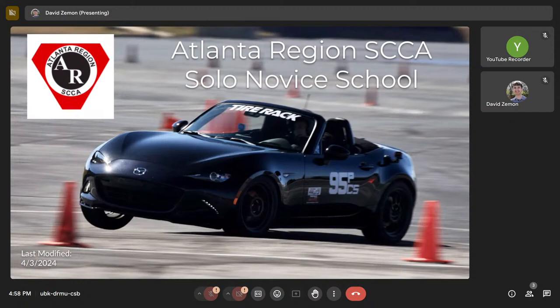What we don't want is you just start at 20. That's too low generally, and work your way up. It's easier to air the tires down, and we'll show you how to do that. Your tires do heat up as the day goes on, because you're putting heat into them, and that causes your pressures to go up. So do know, if you start them at 30 when it's cold out, they're probably going to creep up, and you may need to manage them. And a ton of us are going to have tire gauges while we're there.